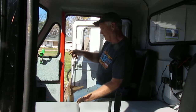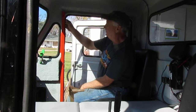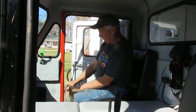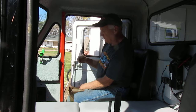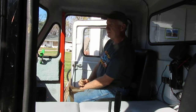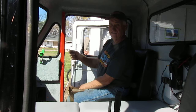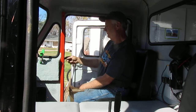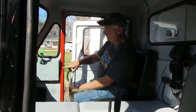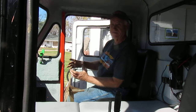What I've done is after I got that set in there, I tested it a few times. I made sure I had enough room to put my gasket back on, which I did in advance. And then I used rivets like you use on race cars. They're 3/16. They have a pretty large head, almost 3/8, and they're multi-width. They'll go in just as happy in 3/16 depth or 3/8 depth. They compress down. You can see the back of 2 of them here. They're going through fiberglass, the latch plate in here, and they're still long enough to hold. And a whole box of 300 of them is around $10.